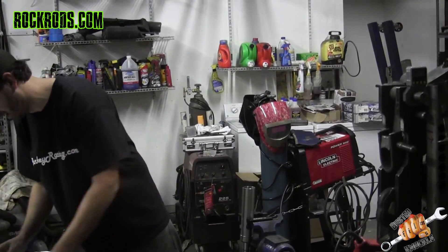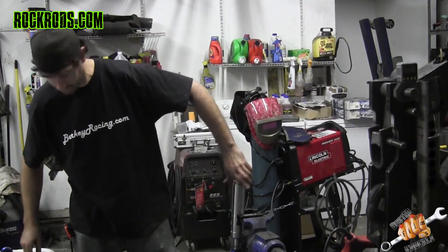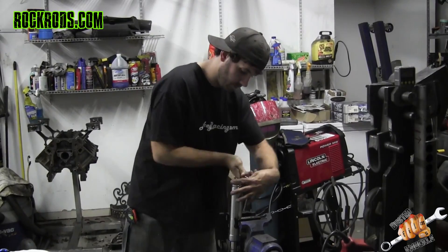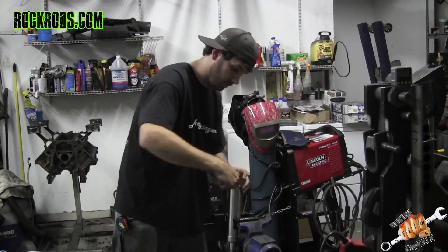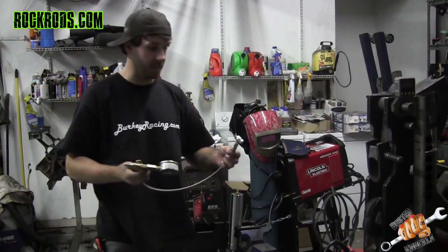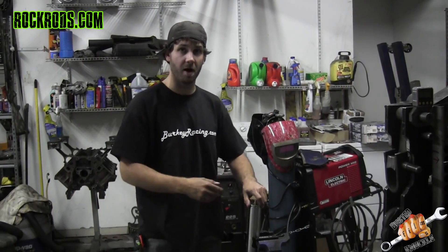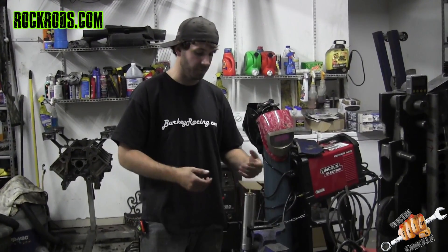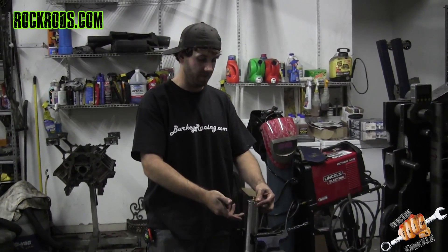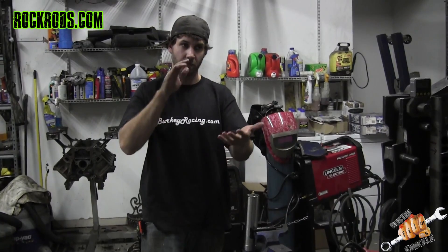Put your cap back on — remember what I said about that o-ring, make sure it's nice and clean. Put your cap back on and use the spanner wrench to tighten everything back down. Then charge it back up with nitrogen — run these about 200 psi, plus or minus depending on your situation. If you're hitting big hard stuff and landing hard and it's bottoming out, go up on the nitrogen. If when it compresses it throws the suspension down really hard, you can adjust the valving inside the rebound so it compresses hard but rebounds slowly, which should keep you from hitting a rock face and bouncing.